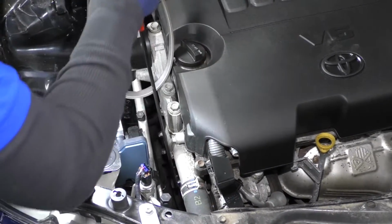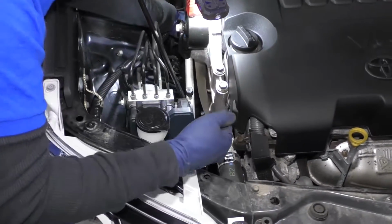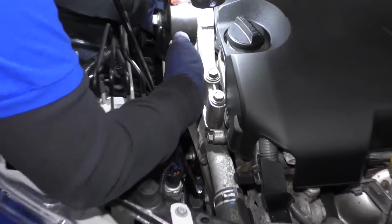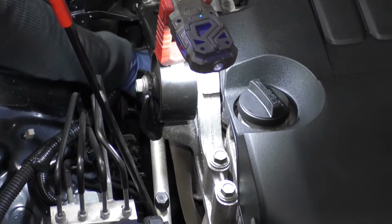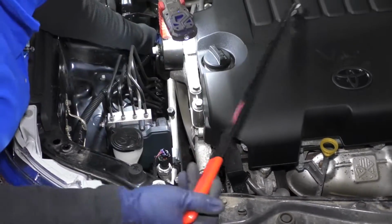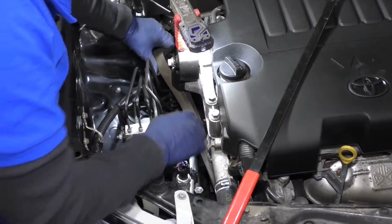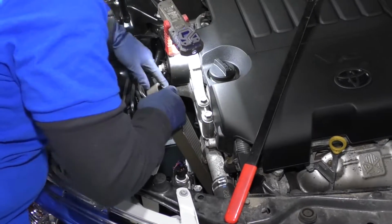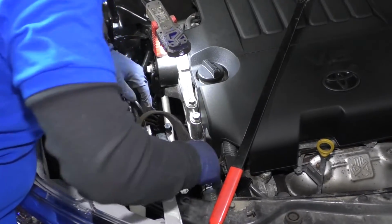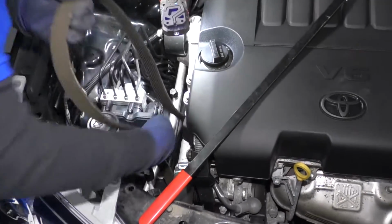And it came off the crank. So I took the belt, it's around the crank, around the pulley, and I brought it out back here under this wishbone mount motor support. So now I can take the tensioner right off and slowly let go of the belt. And then I just slide the belt out, off the crank, pull it right out.